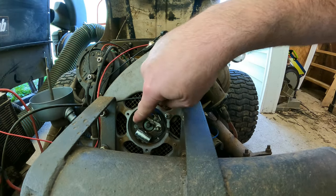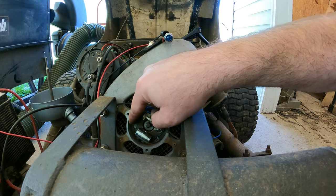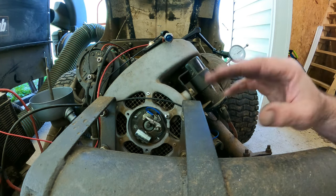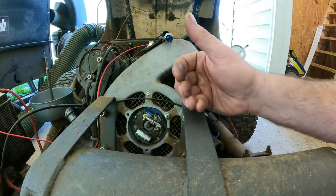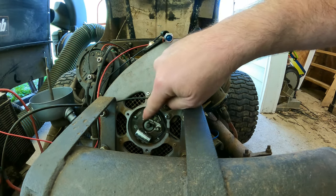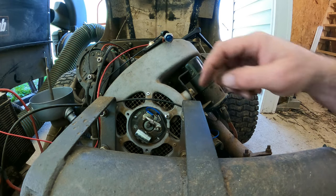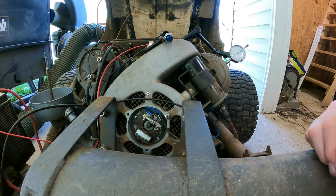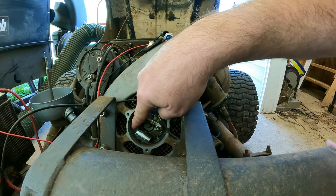After I modified the plate, I noticed there's a line and a dot on the side of the case — I'm assuming that's a factory mark. It's sitting really close to that but just a little bit past it. I don't know if somebody else was in here before, or maybe this isn't the correct inspection plate that came with this engine. I find it very interesting. I could not get those to line up beforehand, so something had to be off. Maybe this inspection plate was out of another engine, or maybe the cam was — it's hard to tell with previous histories.